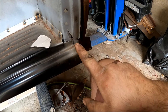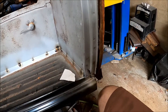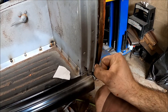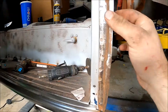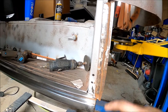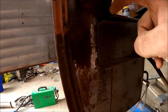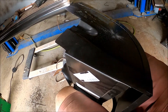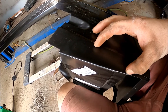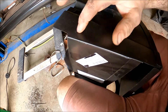Right now I'm going to undo the pinch welds here so that I can go and cut that off and clean this edge up. We used this tool on this edge to get the spot welds — so this is nice and clean now. I will go and throw some weld-through primer on it. I ended up cutting off the little lip that was on it. We're going to cut right here along a nice straight line, and then that part will slide under this lip right here.